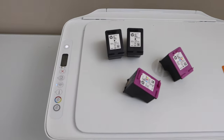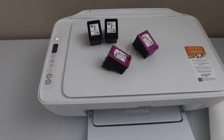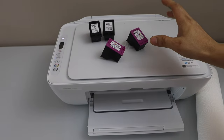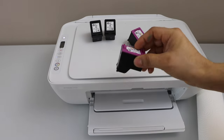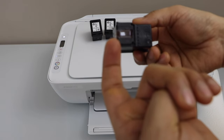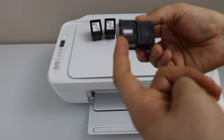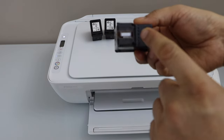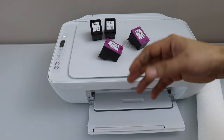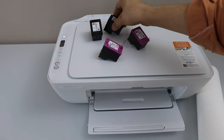You can see the ink cartridges showing up — one is full, another is half — but when you print something, nothing comes out. The reason for this is that if you don't use your printer for a long time, the ink on the print head gets dry. If you touch the print head area, you'll see there is no ink showing up, meaning the print head has dried up even though it shows the previous reading from when it was last used.